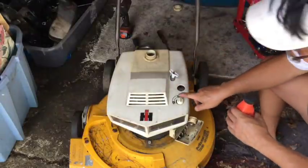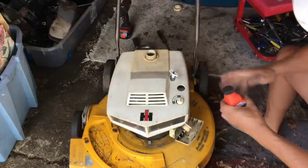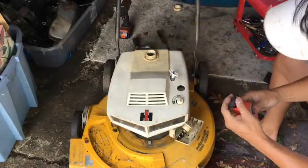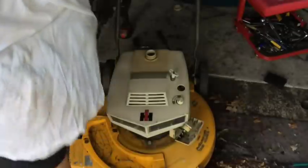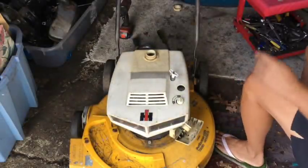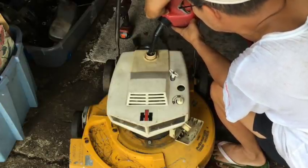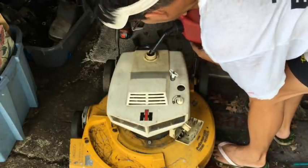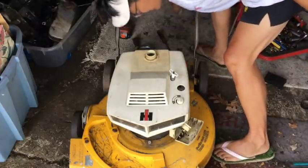I just put the cover on through here. No primer bulb. Primer bulb was over here on the bottom, just to test. Put this thing through there. I used a rag with a long forceps, sprawled it around to wipe away any debris. That's more than enough. Two stroke, probably a 50-to-1 or 40-to-1 ratio. And I like to see a blue sky type of hue, is all you need. Some people put too much two-stroke oil in there and it's black, you know what I mean? You don't need black, you just need a bluish hue is all. At least that's my experience.